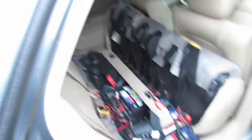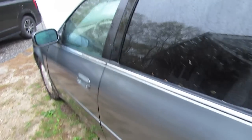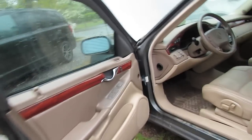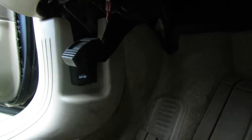I was telling you guys in a previous video that I got a remote start put in my car a while ago, and it seemed like I was having problems ever since then. So bear with me — the wire is actually under here. Unfortunately I don't have four hands. I'm gonna unplug it and then plug it back in just to see where we are. It was point 0.42 on the multimeter — let's close all the doors and see.